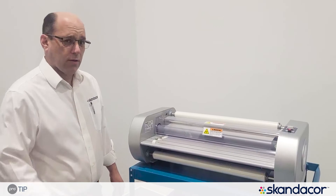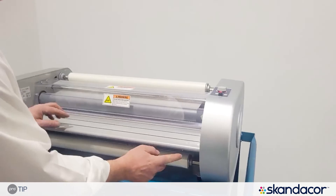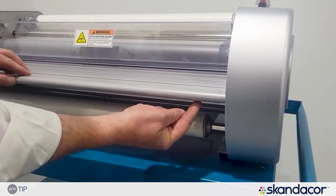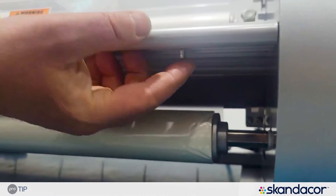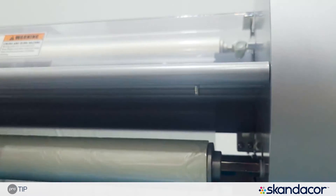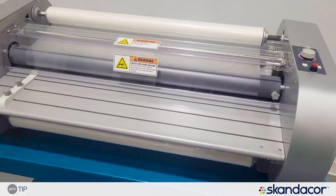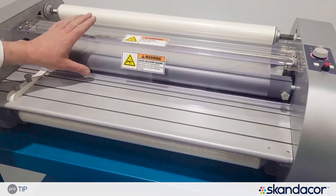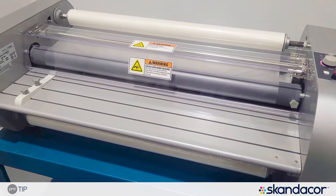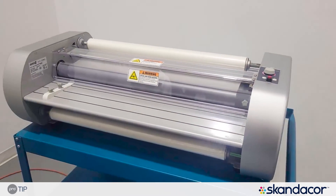So if your laminator is doing this, you want to be careful to check that your tray is in place and that the lever is latched fully and properly. I'm going to show you how much it slides — it slides that much, and it has to slide that much back again. If it doesn't slide that much, it's not locking properly. You also have to make sure that your laminator roll cover is down properly in position. When that is all properly set, your laminator should run just fine. Thank you for watching.